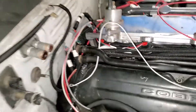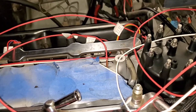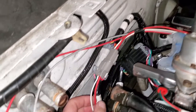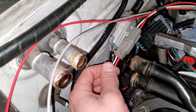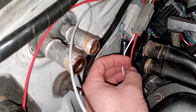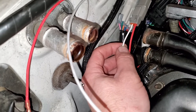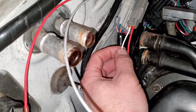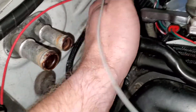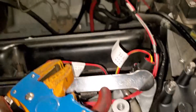I'm trying to run all this stuff nice and neat under the fuel rail. The first Deutsch connector is installed — this is the terminator side for 12 volt battery positive for the fuel pump, and this is the tach or points output going to the MSD Digital Six box. I want this to be serviceable, so it goes into this harness and along and then over.